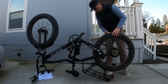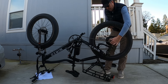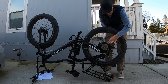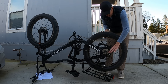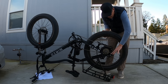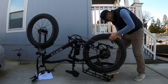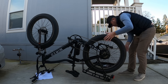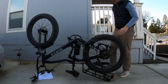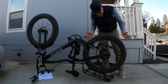I'm going to go ahead and put this wheel back on. The hard part is you need to lift it up and above so that the cassette is connected to the chain, and get it to go on the outside of the chain. Go ahead and line that up — and that's it. It's actually relatively easy. I know a lot of people are worried about taking their rear wheel off like it's a hassle, but it's really not that big of a deal.